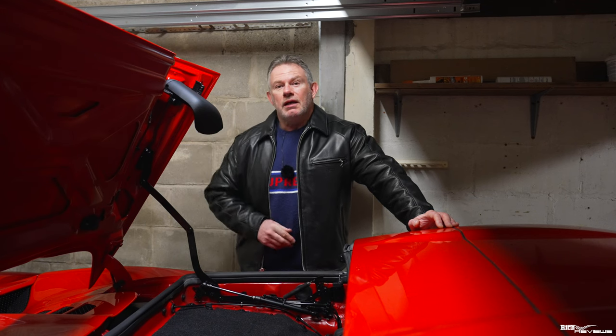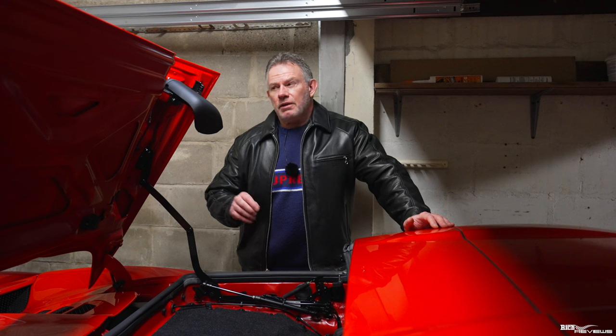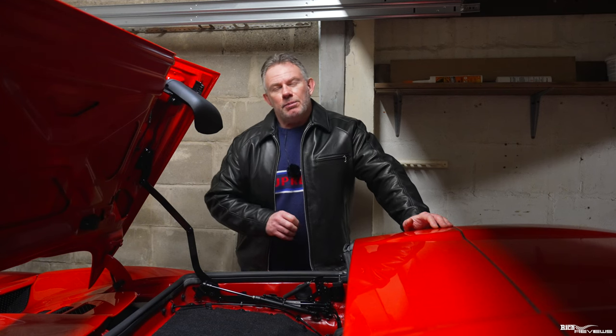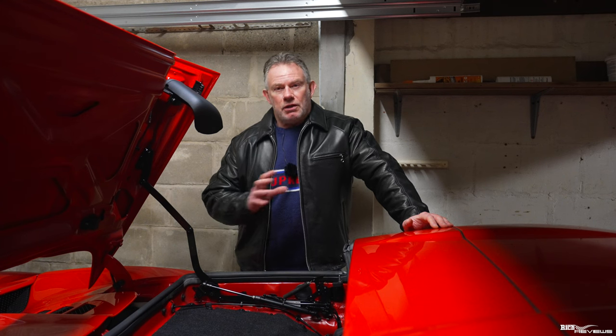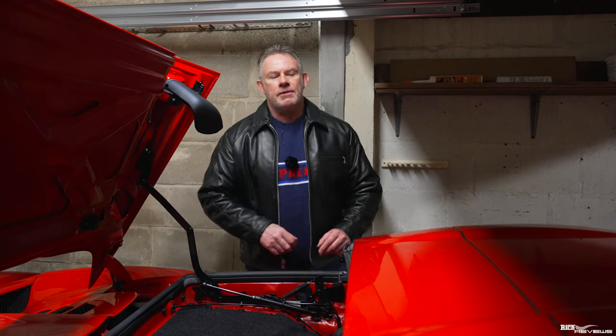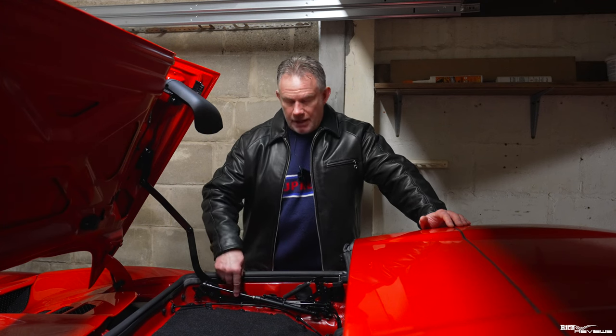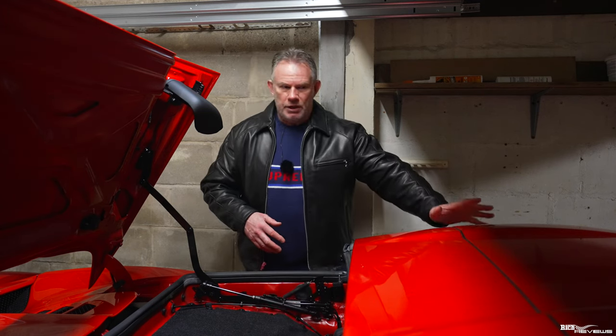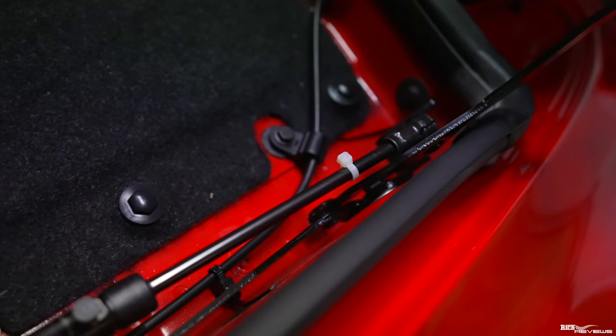There are two main groups of items I'm going to be performing maintenance on: the roof mechanism including the tunnel cover, and the evaporative control system. Moving on to the first item — during the latter part of the summer we started getting a roof mechanism issue where an error came up on the dashboard saying the roof wasn't closing properly and wouldn't lock out. There's a final lockout stage where the tunnel cover closes down and locks in place via hydraulic rams — one near side and one off side — which pull and push the tunnel cover into position.